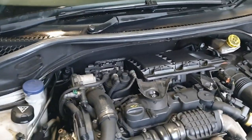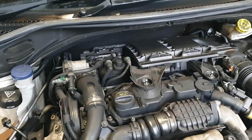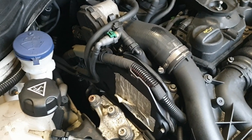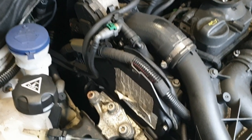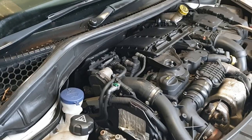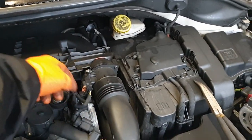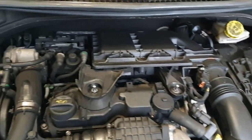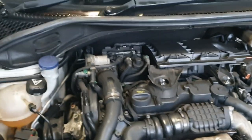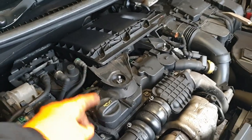The parts are already there, so we're going to strip some bits off the top end quickly, just to confirm, because I'm not sure how they've diagnosed this. This other garage doesn't seem to have taken a lot off, really. Whether they just peeled the top Cambelt cover off. So what we are going to do is airbox off, air flow meter, this pipe, this T-piece, that EGR, I think that's EGR, disconnect all these fuel lines, get this cover off and a rocker cover off, and just check.